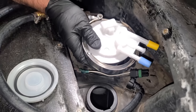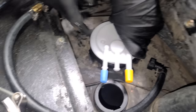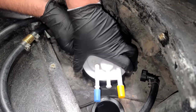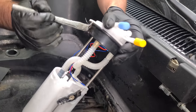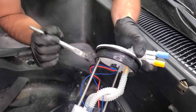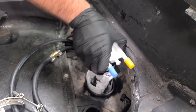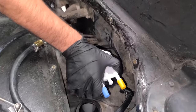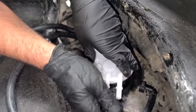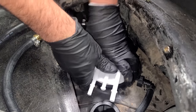So we'll slide this entire assembly in and then figure out which way this has to point. Let's get this out of the way. The instructions say to put it in as an assembly, but I wanna kinda see what's happening here. Now the old Mercedes-Benz sunroof grease does a lot more than lubricating sunroof tracks and getting arms stuck out of fuel tanks. Now be careful with the float arm so we don't damage anything. This is such a perfect size. This is great. And we'll go ahead and take these two off. Okay, now we should be able to push this down. There we go. The seal fits right in the hole.